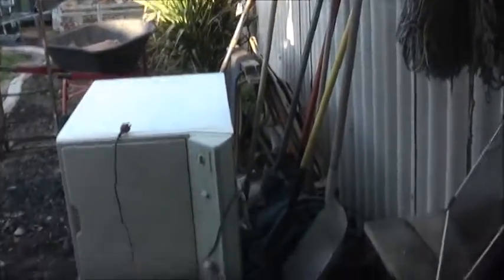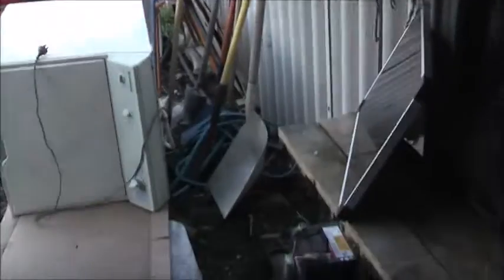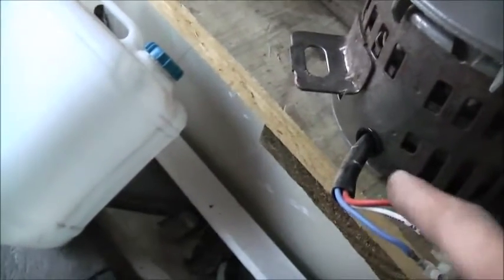If you want to get a three-phase motor, look for these mid to late 1990s Simpson washing machines. You see one on the side of the road and if it's not worth fixing, this is the sort of motor they're most likely to use — grab it, because it's good for a VFD. There's no hot spots or smoke, and based on my readings it's within the tolerances of the VFD. The triac runs between two windings to vary the speed, and one of the other two are switched around for the motor to run backwards — to physically rock backwards and forwards to agitate the machine.